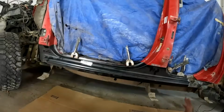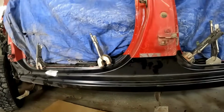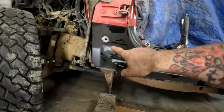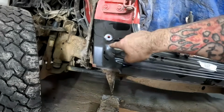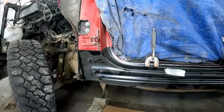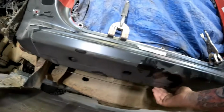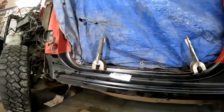So these panels appear to fit really nicely. I've got it just basically clamped in place, kind of overlapped over the metal here and here. But you can see we line up nicely with that factory hole. This panel is up just a hair, but we are overlapped on the metal. So once we cut that out, it'll bring it down to where it needs to be. We're fitting really nicely along that bottom flange. It's actually perfect. It is bang on.